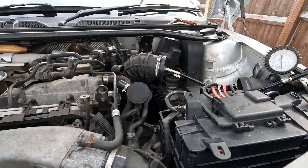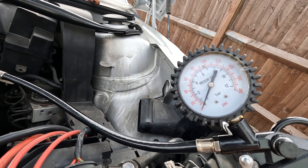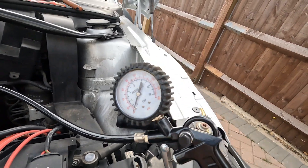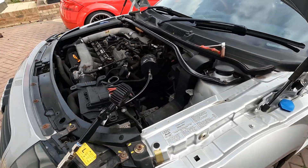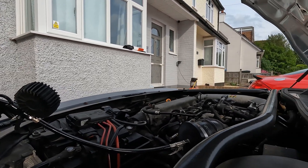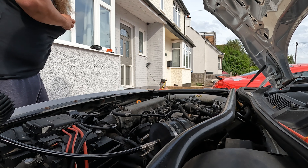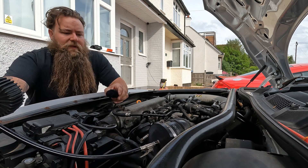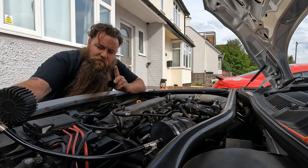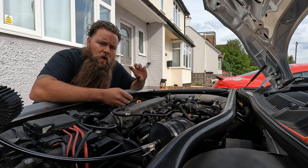What we'll do is start by just pumping this up — you'll see it go up to 20 psi and when you let go it should stay at 20. I'll take my microphone off and offer it around different places in the car. Let me get you set up so you can see what I'm doing. Let me have another go — I'll walk it around the car to places where it might be leaking. Right, I can hear air now. I have a hunch — the brake pedal goes hard almost instantly when you turn the car off.